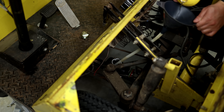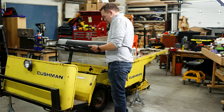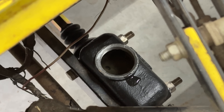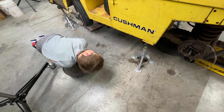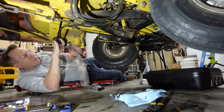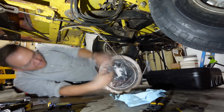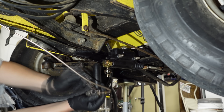Then Malcolm and I tried to bleed the brakes. After a bit of that, we still weren't getting fluid at the brake cylinder, and it wasn't long before we found the culprit. This old stretch of line was like Swiss cheese. So I bent and flared a new brake line and replaced it going back to the flexible line reaching to the back axle. It took me forever to get the fittings to stop leaking. I tightened everything way past the point where I thought these little fasteners would break. But that's what it took. Not fun stuff.